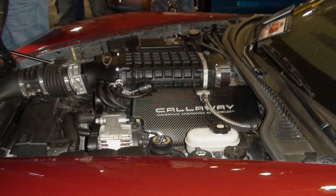The Gen IV 5.3L engines share all the improvements and refinements found in other Gen IV engines. Eight versions of the Gen IV 5.3L engine were produced: 3 iron blocks and 5 aluminum blocks — LH6, LH8, LH9, LC9, and LS4. All versions featured active fuel management except for the LH8, LH9, and LMF.